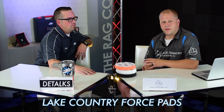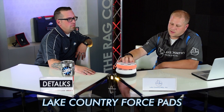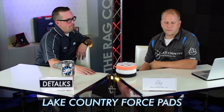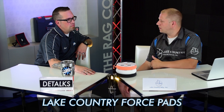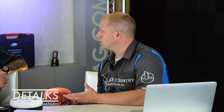They have a slightly thicker pad to provide a better user experience. One of the unique things about a forced rotation machine is it takes the best of both worlds — you get your rotary and your DA. But having it as a dual action tool, you can still use downward pressure and it'll rotate. So when you have a little extra meat in there, you can really adjust your pressure and fine-tune your technique to get your desired result.